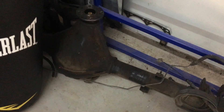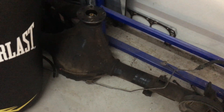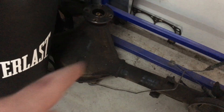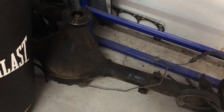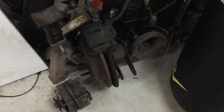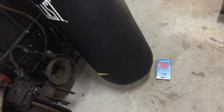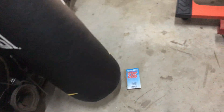I'm using the flat flange tail shaft off an EF XR8. The diff itself is shot — it's completely knackered. It's actually a limited slip, 2.73 ratio, but it's junk, absolutely wrecked. So the easiest way is change the quills, change the mounts — takes about half an hour to pull them off, welding will probably take another hour to hour and a half. I'll paint the diff and away we go.